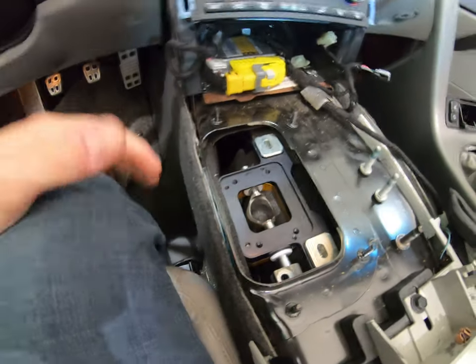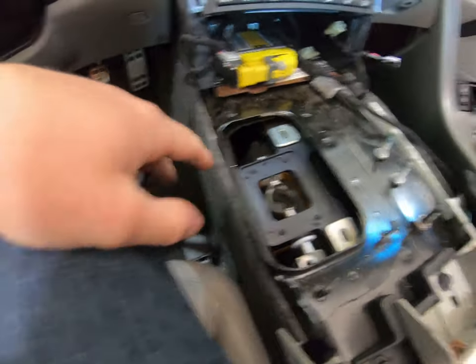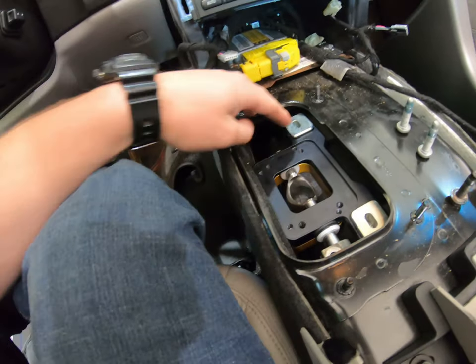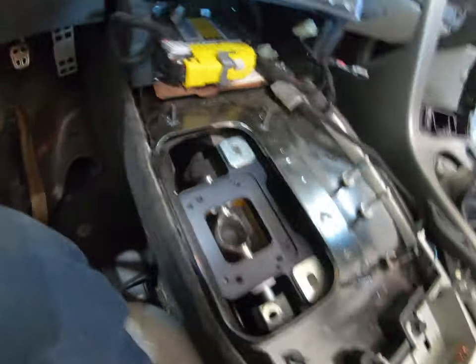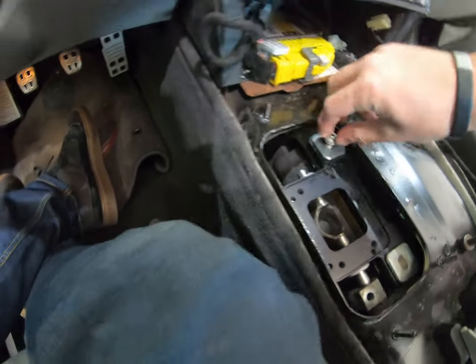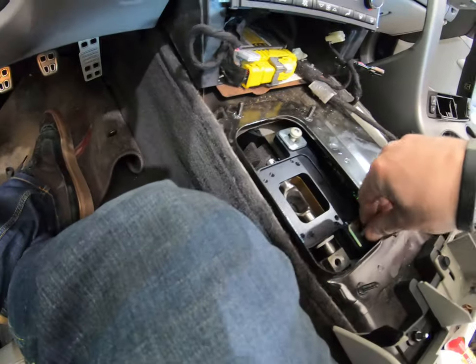It's been about an hour, but we did end up getting those lines out of the way. They are the trans cooler lines. I waited for my dad to get here because he's done so many of these and I wasn't sure what we could bend safely. He ended up bending those out of the way for me. Everything's still the way it's supposed to be. Now the lower box fits in. You got the linkage connected. Go ahead and put the bolts in just hand tight for now.